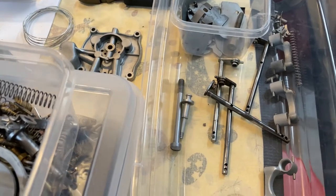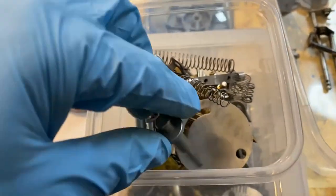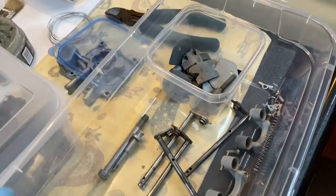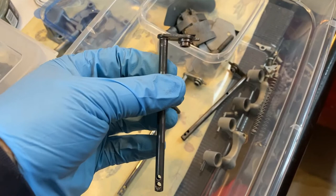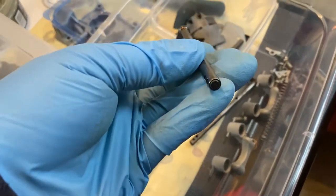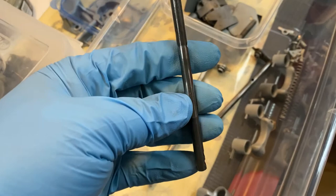You can tell when you look at these parts — they're very clean, having been blasted in the glass bead cabinet. It makes them very nice. Of course, not everything should be blasted. I don't blast the bases, and I don't blast these rods for the accelerator pump. If you know anything about these, they're vented — hollow — and there's really no way to clean them out all the way through, so I use a wire wheel for those instead.